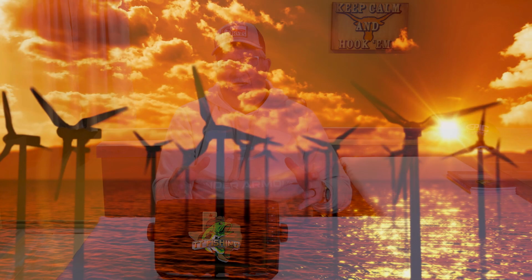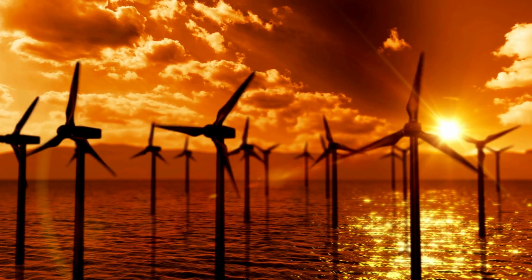Number one starts when you're installing your unit. If you have a brand new unit that you just bought and you're thinking about mounting it inside a console or something like that, and you don't have a canopy over it to shade that screen a little bit, that could cause some problems, because the internal temperature device could be shutting it down. You want to keep some airflow around that unit if possible. Like me, my console unit has the windshield right behind it, so it doesn't get good airflow. I've been thinking about moving it, but my unit has never shut down on me, though that screen gets awfully hot, just like a lot of you have experienced.